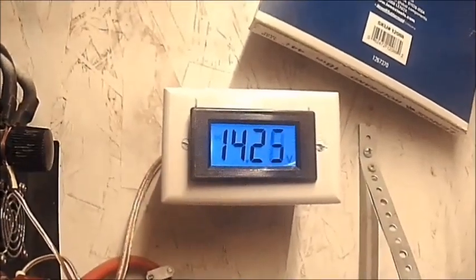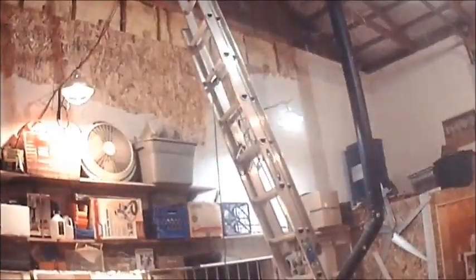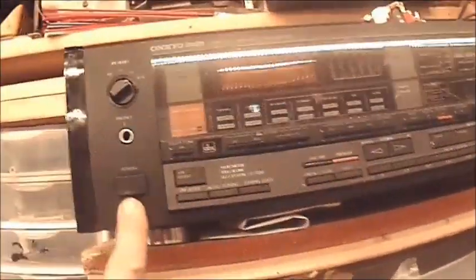As you can see, this is the voltage as it's being kept down. I'm pulling roughly 5.2 amps lighting all of this up — that's 5.2 amps lighting every bit of this with all LEDs. I'm pulling about another 75 watts on the inverter. The whole system — including the stereo, the big Onkyo, it's on the Rode Pro true sine wave — even this one is all on inverters. I've got a big spare inverter I've never installed as backup. So far those peaks have never failed on me.